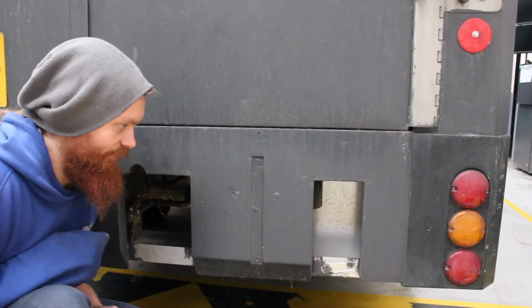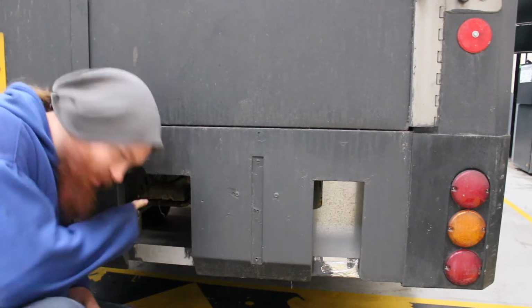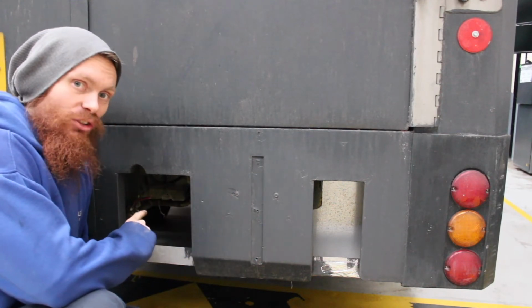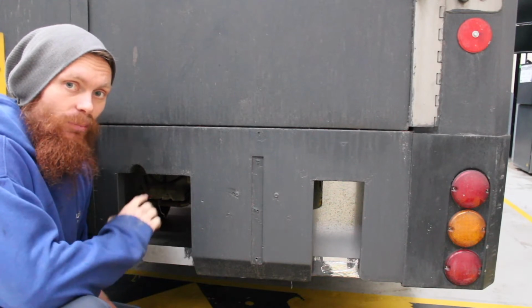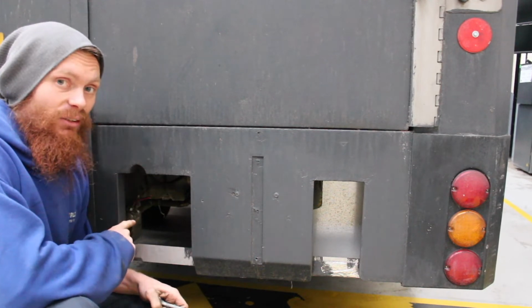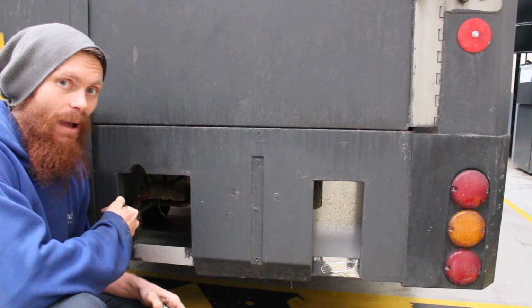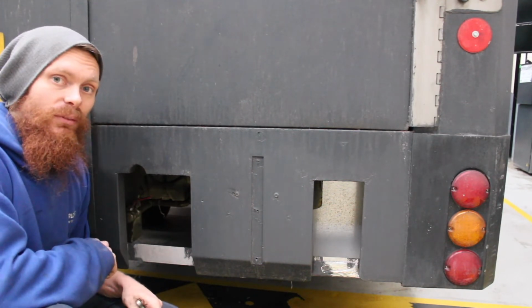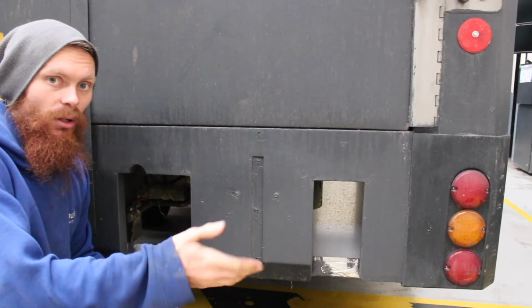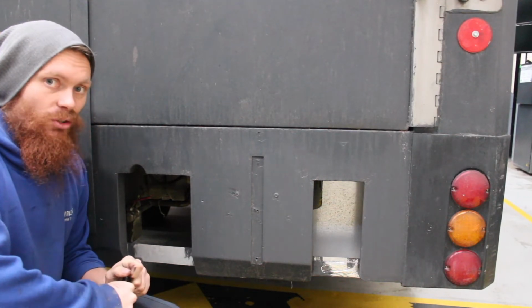Unlike a lot of other self-built campers, I do actually carry a waste tank. It's just in there. I'm going to plate this off at some point, but just in there are 2 25 litre barrels that have been clamped up together, and tank connectors put in through the lids, and then I've just made out of copper pipe and a bit of tap, just a way to drain it. So I empty it into a bucket and then put it down either a toilet or a drain, whatever's suitable at the time. So making sure that it is legal and safe to do where I am dropping it.